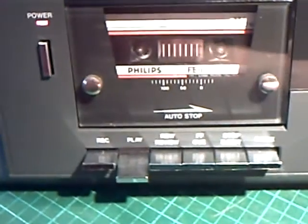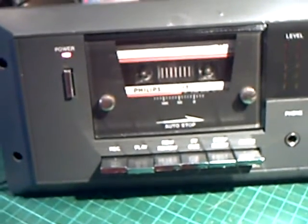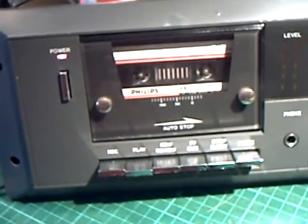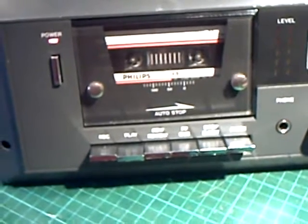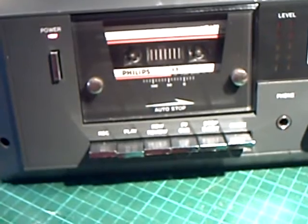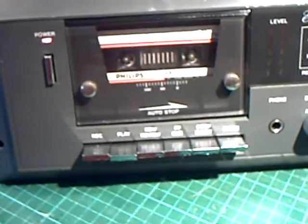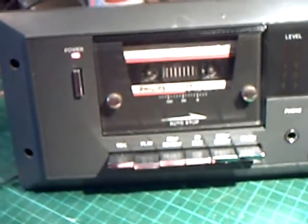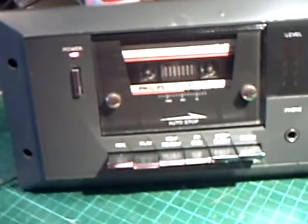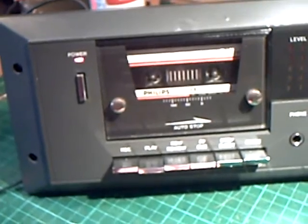Not a bad sound, really, for what it is. It only uses 11 watts, so what's it going to be putting out? About 2 watts RMS per channel, if that, I suppose. But not bad. The cassette mechanism itself is the sort they used to use in music centres and the better boom boxes — it has a big heavy metal flywheel and it's driven by a flat belt. I've actually seen this mechanism in the Ferguson Cassiever as well — the later ones, I think it was. So yeah, about the same time I suppose — '79, 1980.